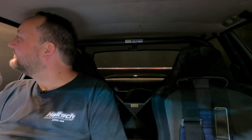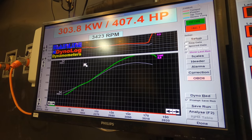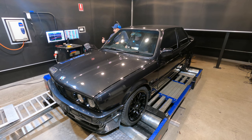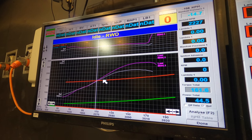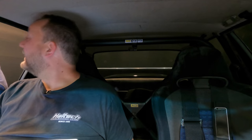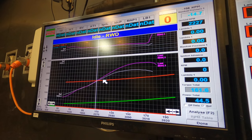Track 300 — not bad, that's tough in an LS. It's an awesome mod to do to these motors. From about 3,600 RPM and above we've seen a nice gain; below 3,600 RPM it's pretty similar to what we had — hasn't really lost any grunt down low. You can see that in the fuel map too: down low where this cam is not as efficient as the factory cam, we've had to pull a little bit of fuel out because we've got less airflow. But up top, more fuel has gone back in because we've got more airflow.